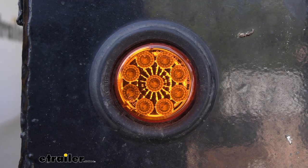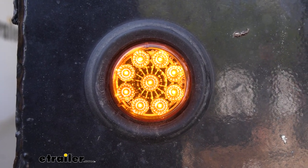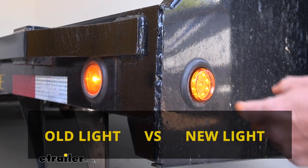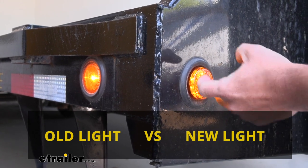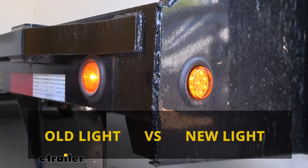With the lights hooked up, I'm going to turn it on. We have the taillights on right now. You can see how bright that light is coming through on that LED. You can see these side by side here — this one's quite a bit brighter with that more clear lens up front and the Miraflex in the background. It's got more diodes in it as well, so it's going to stand out far more than the one we replaced.